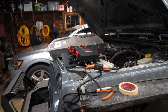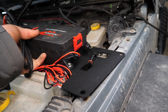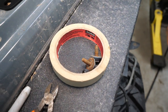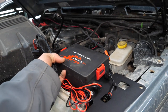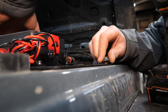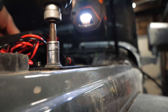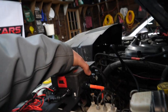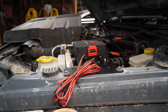I'm not going to hook up the optional ignition power source yet — I like to turn on the light bars with the vehicle off and key out sometimes. Very similar to the first unit, I'm going to bring it in just like so to mount up right here, making sure no wires get pinched. We'll reinstall these two factory 10-millimeter bolts, and the Voswitch will be mounted up. Looks like I gotta reverse my cover and we'll be good to go. That is nice and secure.